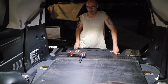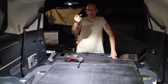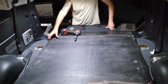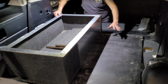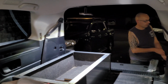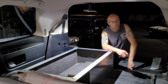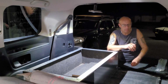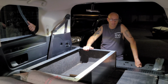So I've got the base plate in. All it mounts down to the factory tie down points. So you just unbolt them. They're a 10mm bolt. And then there's four recessed holes in the base plate that it bolts down. That's been a bit tricky. We didn't have all the fitting kit or any instructions. So I bolted it down once and it wasn't level, so I had to go and find some little plastic feet just to space up underneath it. So it just bolted down nice and level, nice and straight, which is about as close as it's going to get now.